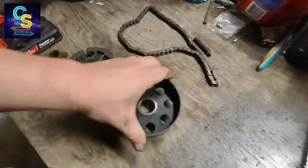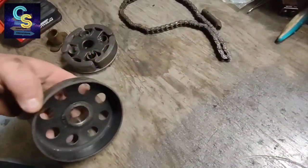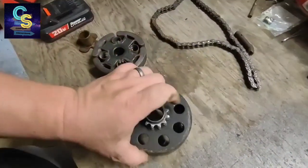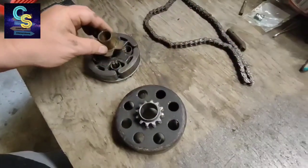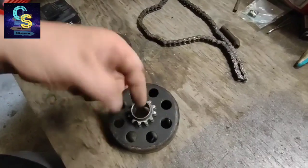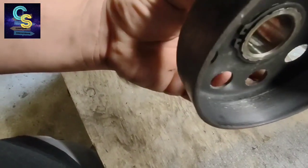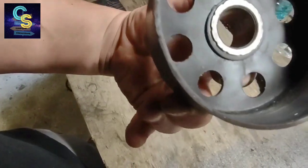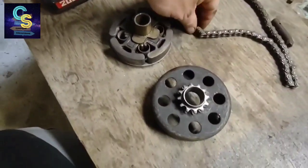And that'll be ready. Same thing with this. Hit it with a little bit of sandpaper on the inside. A little bit of brake clean. Get it oiled. It gets oiled right here. This gets oiled just on the outside. Nothing on the inside. Just enough to keep it nice and smooth. If this ever looks scored or pitted, it's because you didn't oil it enough, and it'll lock up. If you start it alone, it'll go flying.